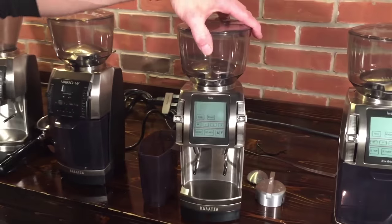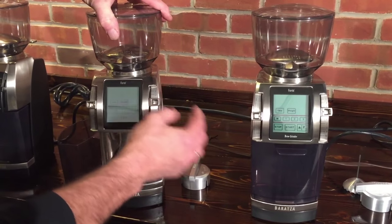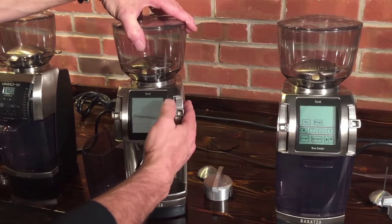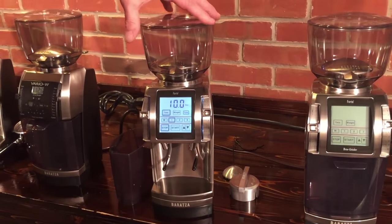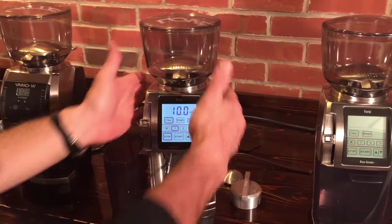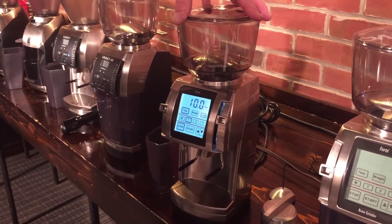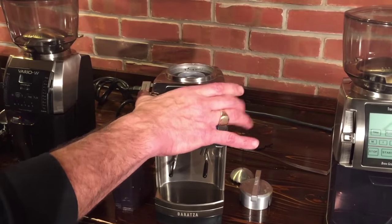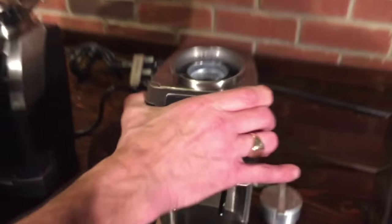Now up to the Fortes. These come with lovely touch screens. That first version is the Forte AP. It has the nicer hopper as well. The Fortes are all metal. The AP model has that same 54mm ceramic burr inside. It also comes with some tools — with the Varios and the Fortes you get a tool for removing the top burr, plus calibration tools. Every once in a while you're going to calibrate your grinder, and on the Varios and Fortes there's an easy calibration tool that goes up into the hole. On the Preciso, Virtuoso, and Encore, adjusting calibration is a little more labor intensive.